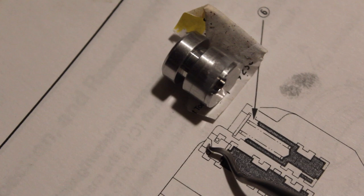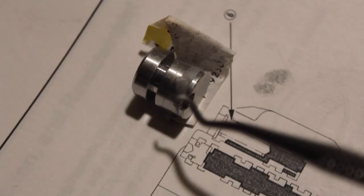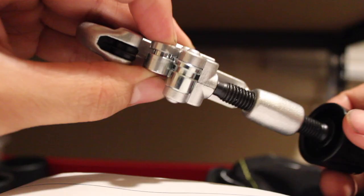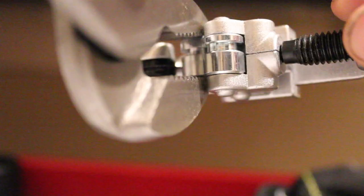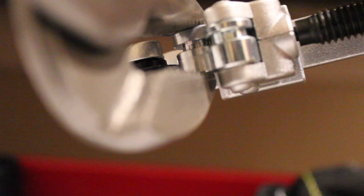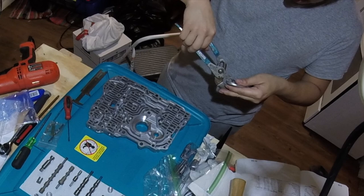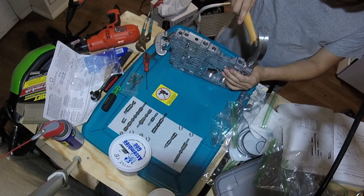Here's a quick explanation with a diagram. That's the end plug. This is the clip that holds it in, and it goes in this groove right here. You want to use your pipe cutter to cut a small groove right across this section, about here on the plug. This is the kind of pipe cutter you need. Put the plug in it like this, tighten it down but don't crank it down — you just want to make a small groove. Then use some pliers to turn the plug until the groove is all the way around it. It makes a tiny lip so the plug makes a better seal with the valve body. If you put it in and it's really loose, you want to make the groove deeper. It should be kind of hard to push into the bore — you may need to tap it with a hammer. Make sure you have the valve in right, because it'll be hard to get the plug back out.